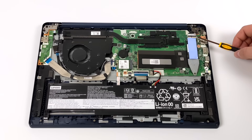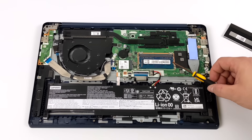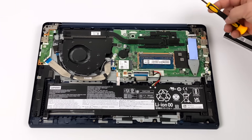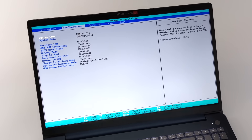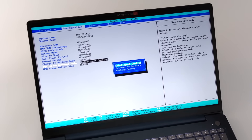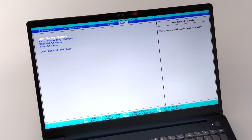I pulled the bottom off so you can take a look. We have a user-replaceable M.2 and a single stick of DDR4 running at 3200 megahertz — a 4 gig stick. The maximum you can put in here is 16, but remember we have 4 gigabytes soldered to the board, so maximum total is 20 gigabytes. In the BIOS there are two important settings: system performance — set to intelligent cooling by default, keeping the CPU around 13 to 15 watts. I'm switching to extreme performance, which takes the TDP up to 30 watts. The second setting is VRAM allocation for the built-in Radeon GPU, which can go up to 2 gigs.